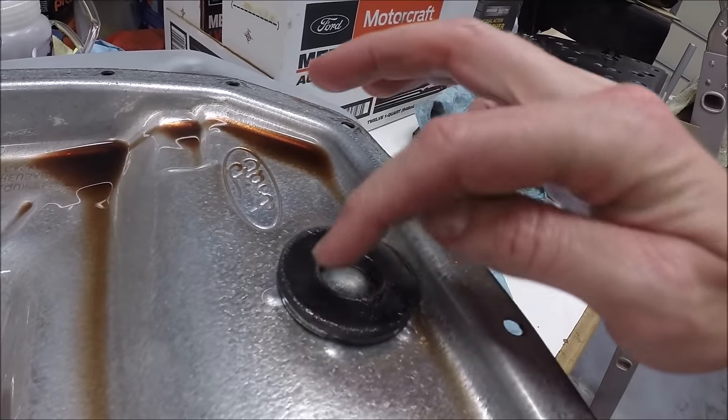Here's how I'm going to pump the new transmission fluid in. You can get one of these little hand pumps that screw onto the top of a quart bottle. Most automotive hardware stores - Advance Auto Parts, CarQuest, that sort of thing - would have these. We'll run the line up to where that little dipstick tube we took out originally - that's where we start filling from.